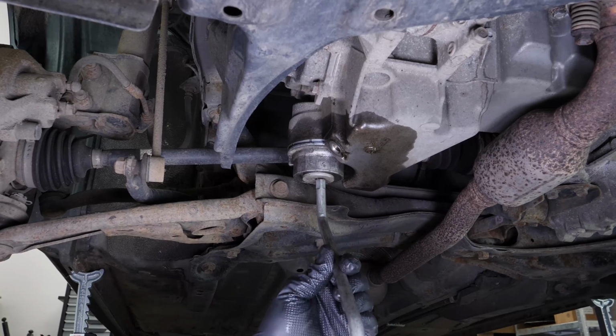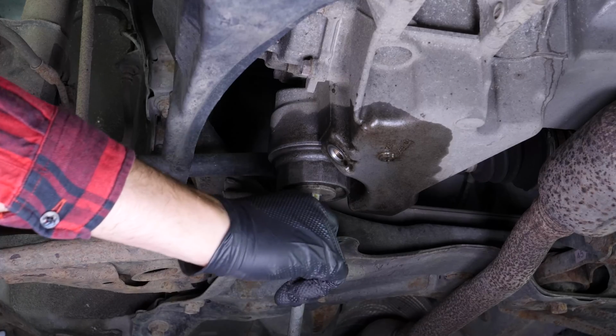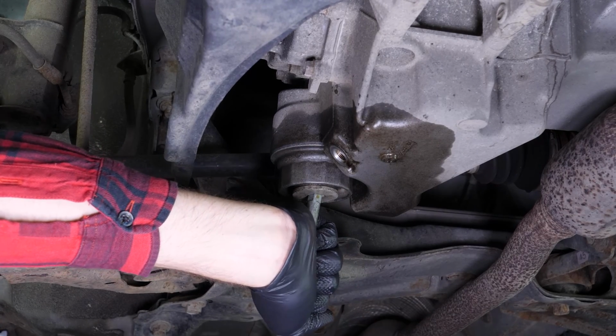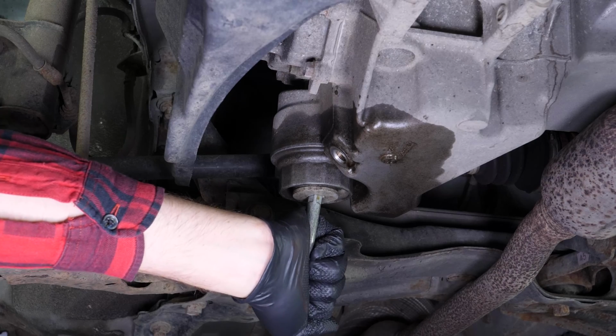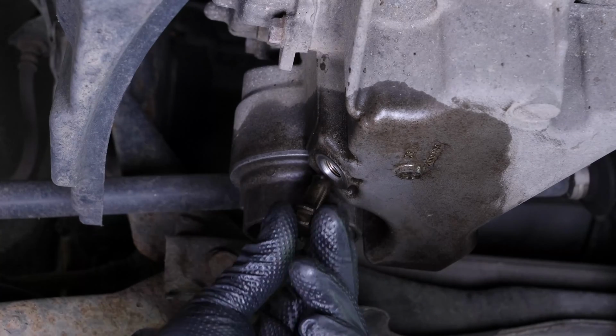For the tightening process, use your oil filter spanner. Careful, with this kind of oil filter, the new joint can be excessively thick, making the actual tightening process more complicated. As a result, you have to ensure that the flange washer is flat against the oil filter housing.